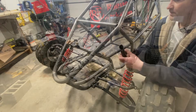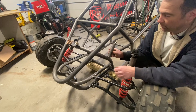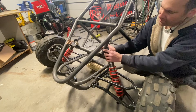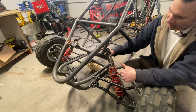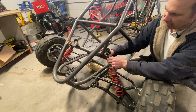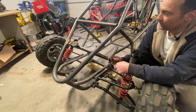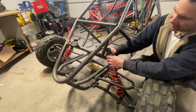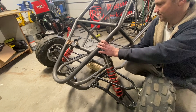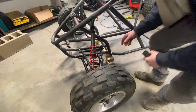We need a place to start, and that starting point is the mount for the shock. Since I've changed out the front A-arms, I may need to trim this more. Looks like we're going to get a little bit of stiction — which is side play on your shock — if we mount it here. So these are longer; I've already trimmed this one but I'm just going to trim it a little more and get this aligned a little better. Only needs to be trimmed maybe an inch or so, so I'm going to take this measurement.